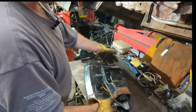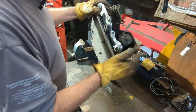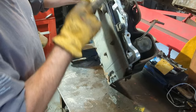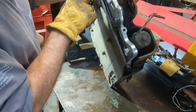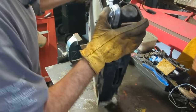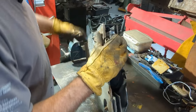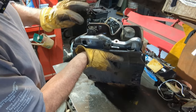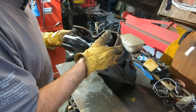I just want to go through what's in this assembly. Of course there's the glass. There's the motor right there, and this is the bottom frame that holds the glass in. There's a track here, a track there, and a track down in there — those are guide tracks. There's also a felt guide track up here. So there's two felt guide tracks and three tracks that are rollers. There's a lot of tracks, a piece of glass, the motor, and the window regulators — all tied together.